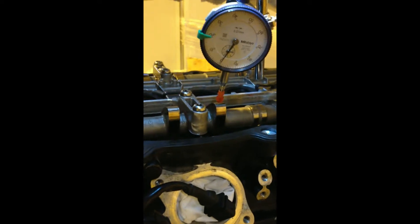I'm going to go ahead and turn over the engine here by hand using this ratchet and socket, so it will turn the crank over, and that gear down there in the centre of the screen that the socket is sitting on will turn the cam chain, which will turn the cam.